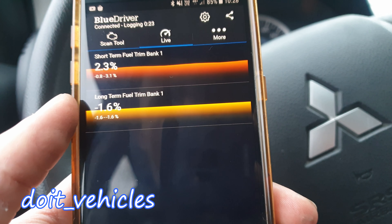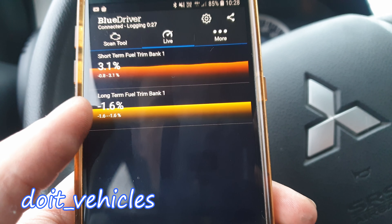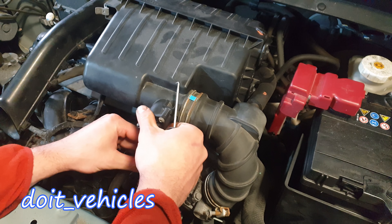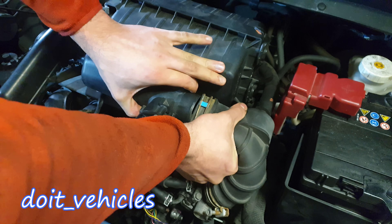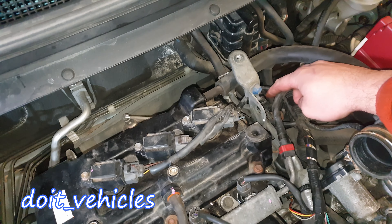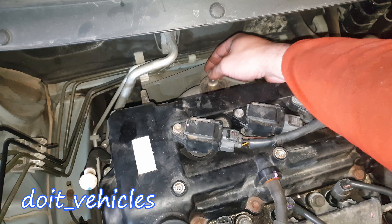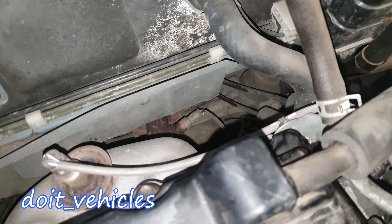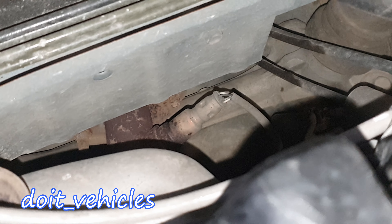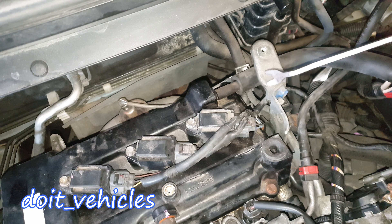If for example you've got an air leak which persists for a long time, you will see it here. Let's take out this air filter housing. If you have a look here you're going to find the connector for the first oxygen sensor and the sensor itself. And down there you're going to see the second oxygen sensor, which is responsible for the catalytic converter.